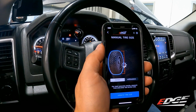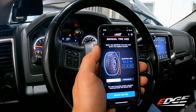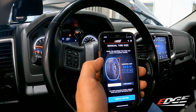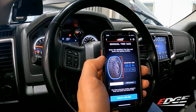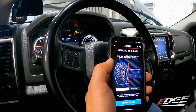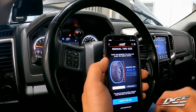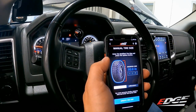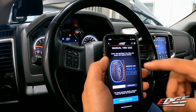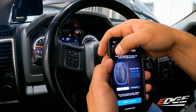In the tire size adjustment menu, you can set your modified tire size so the speedometer reads correctly for larger tires. Don't input the size printed on the tire — a 35x12.50x20 tire typically only measures about 33.75 inches tall when mounted. A 37-inch tire normally stands about 35.5 inches. Input the actual measured tire height for the most accurate speedometer reading. You can verify accuracy using a GPS input from your phone. Once you update the tire size in the app, it updates the module so the speedometer reads correctly.